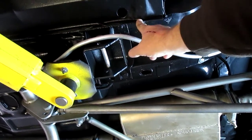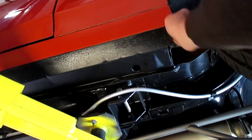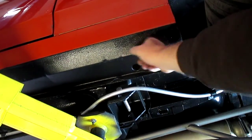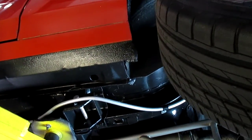The pinch welds in the original part of the car are still in great shape. It looks like maybe a little bit of work done right in here, but this all seems to be solid metal in this whole car — doesn't look like they've taken and bondo'd up the car. Let's move back here towards the rear.